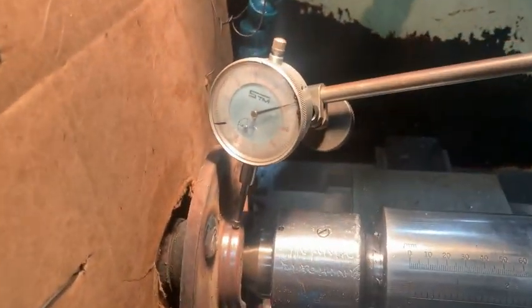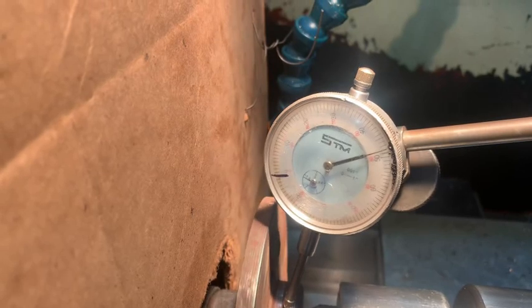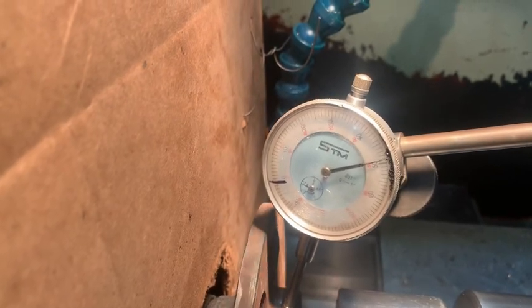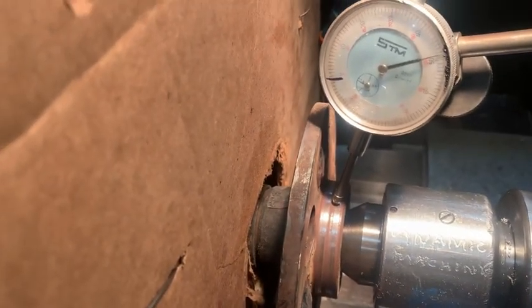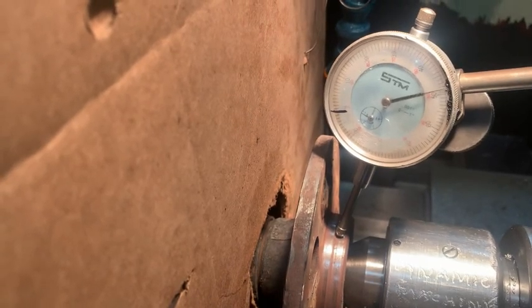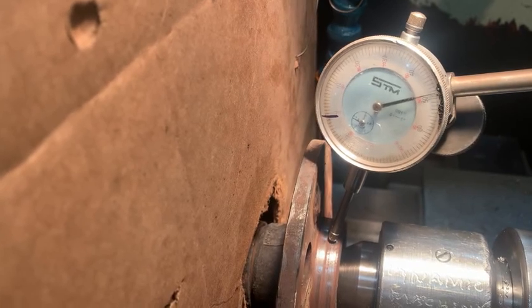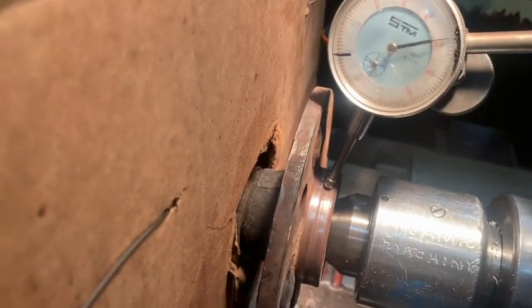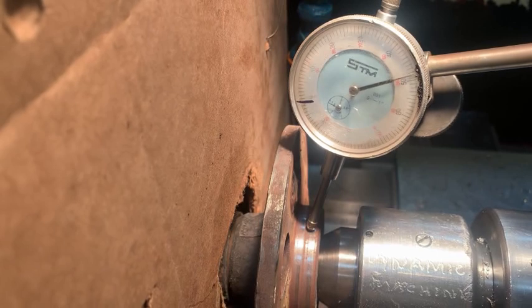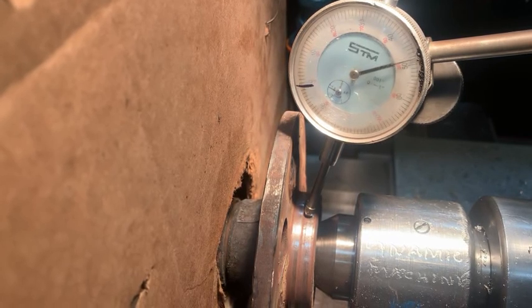Same thing on axle number two. I'm running out about a thousandth of an inch, maybe just a thou and a bit. A little bit of rust and crud didn't fully clean up there, but it's good. Back where the seal area is, it's within well under half a thou. The face on this one runs out about six or seven thou — same thing, wouldn't be surprised if it was like that from the factory. You run into all sorts of crap or someone's tagged curbs over the years. There are some hits on this thing — probably from the '60s or '70s. So we'll get this one faced and get them flipped around and on to the next.